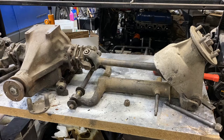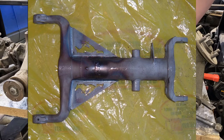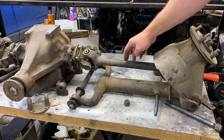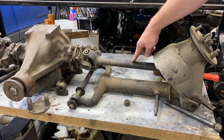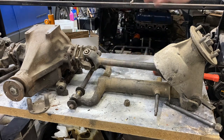Underneath that we have the wishbone, which is this piece right here, and it connects to the carrier and to the differential. It's really simple to shorten or lengthen — you just cut it. When I did mine, I cut it, had a sleeve made that went inside, welded the whole thing up, and then we gusseted across where it was cut. Because you have the wishbone or lower control arm, and then what holds the upright up is the half shaft, there's no extra modifications to make. You don't have to shorten an upper control arm because this shaft serves as the upper control arm.